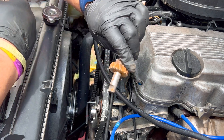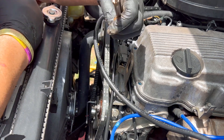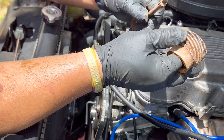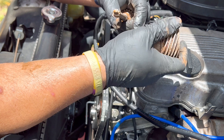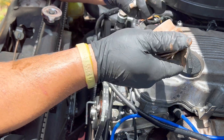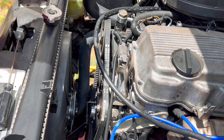I ended up replacing the shaft that goes to the oil pump and the distributor. When I did that it did start up and that's when it ran good for one day, but then it fell out of timing. I figured the gear that goes on the crank was the issue, so I ended up buying a new one and had to take everything apart again. It's still doing it, so I'm thinking it's because I have an aftermarket timing chain that I can't get lined up right.